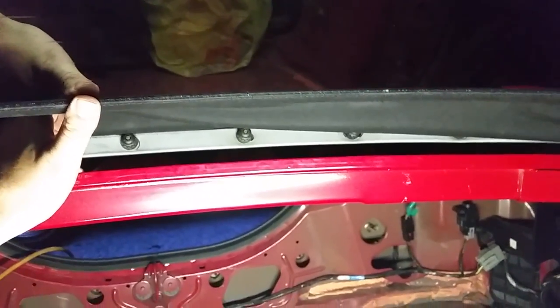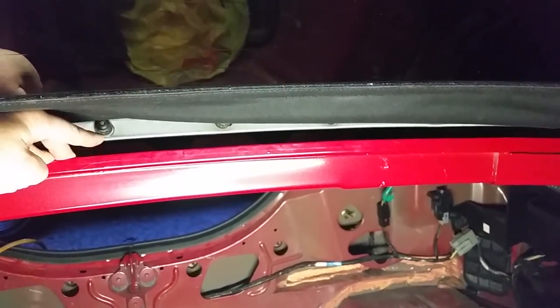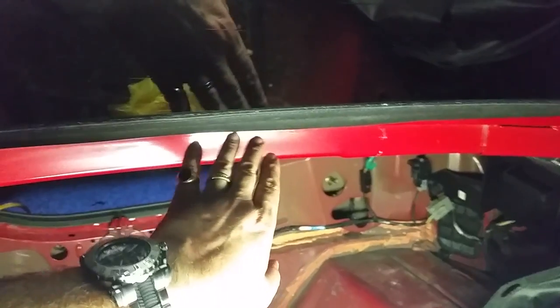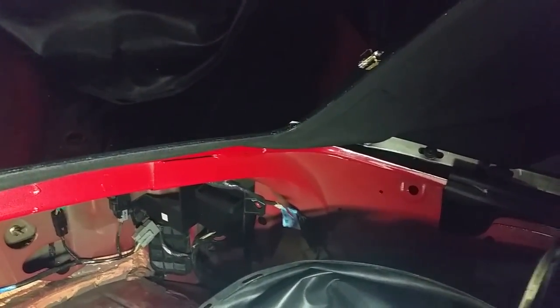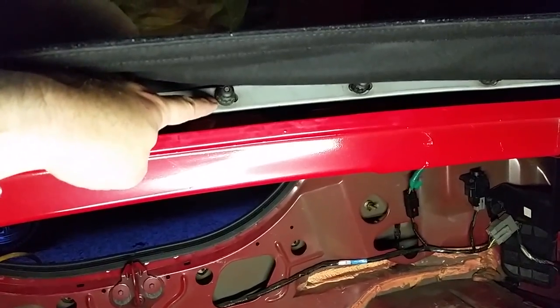Okay, one last thing is, as you start to tighten these up, I have all the nuts on, you want to start from the center of the car and tighten the nuts up going to the outside edge, and then do the other side to the outside edge, and then once you get all the center to the outside edge tightened up, then go to the outer strips and tighten them up. And don't forget, it's a 13 millimeter 12 point deep well socket. You need a deep well to get over the button head of these, to get down to the teeth.